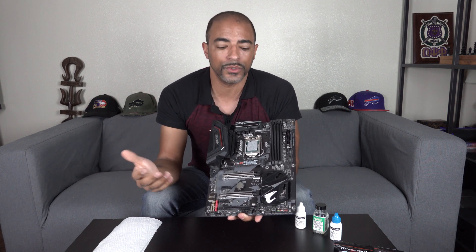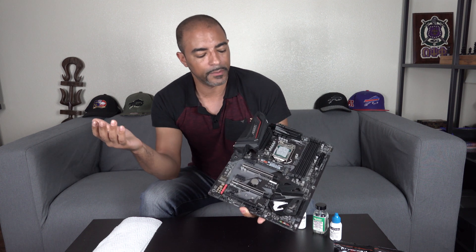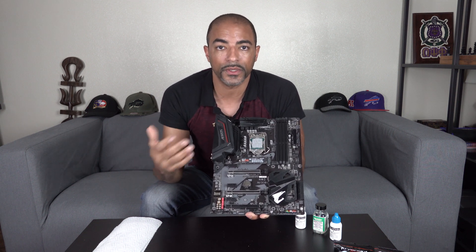I took this motherboard out because I had to move some things around in my office — great time to do some maintenance. This is a Gigabyte Aorus Z370 Wi-Fi motherboard. It did the job for my office environment, but it was an i3 so I wanted to overclock it a bit further. Temperatures on an eighth gen processor are something you have to be concerned about because they use horrible thermal compound underneath the IHS. So what I did was I delided it — I took off the IHS to expose the actual die, scraped all the black gunk off, and applied liquid metal.